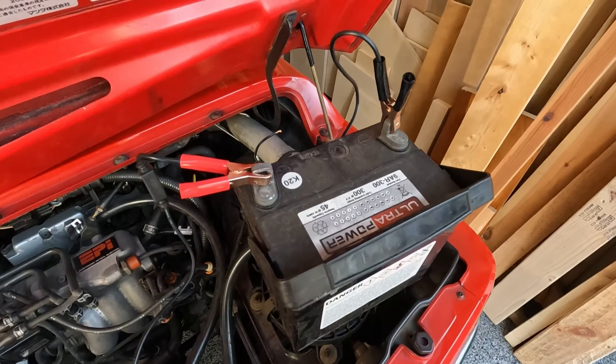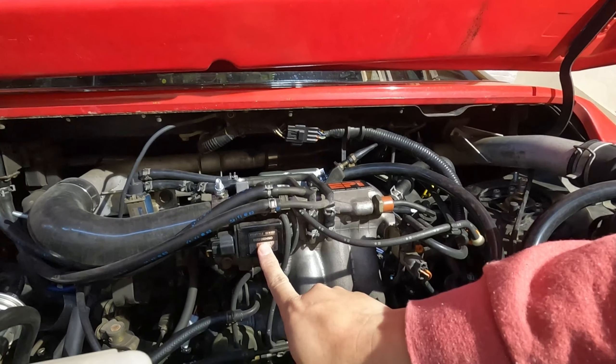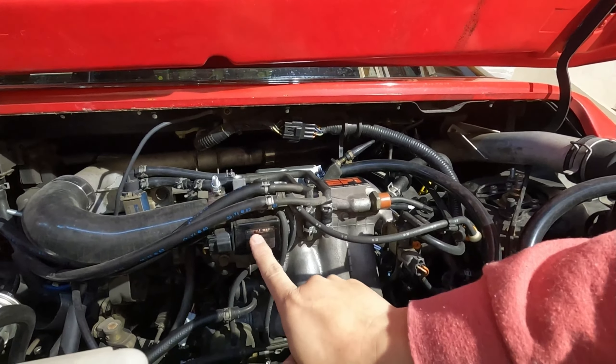That's what it's supposed to do. This is the ABV — the air bypass valve — a vacuum solenoid. The ECU tells this to open when the throttle closes to open up the blow-off valve so it can release the excess pressure, so I don't get flutter and surge. I tested this — it clearly works when I apply 12 volts manually. If I bypass it, the idle valve keeps clicking, so the engine is struggling to keep idle. Theoretically, something's wrong with my throttle sensor or my ECU.